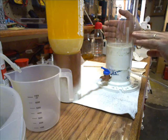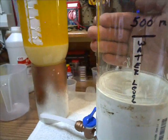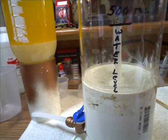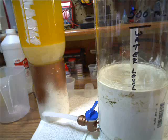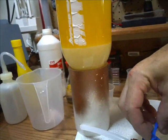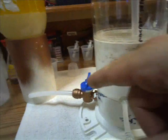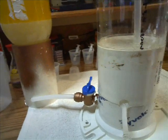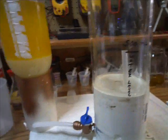I like to use 500 milliliters of water, and you can see the 500 milliliter mark — that's my water line, level with that standpipe right there. What I do is leave my oil drain open and dump my hot water in there until it comes out the oil drain. Once that's done, I know I've got my water level where I want it, then I shut it off and start adding my oil.